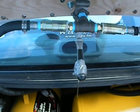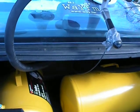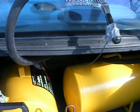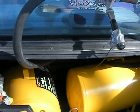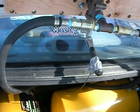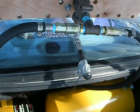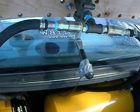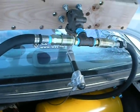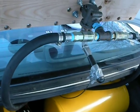Another thing you can do with your valve — instead of having a manual valve, on this one I run a wire right straight up to the driver's seat, and I can pull on that cable and that's what pulls the valve. The cable runs all the way through the back seat up to the front driver's seat, so I just give it a tug and that pulls the valve open. But you can also do a solenoid — a 12-volt electronic solenoid — that would connect there in place of the manual valve. With a solenoid it's either on or off, full blast or nothing. With a manual valve you can meter the air, slowly bring them on, and use just a little bit of air at a time.